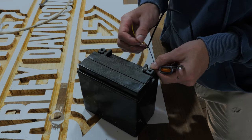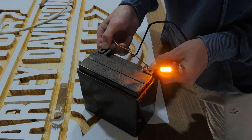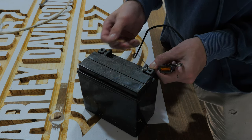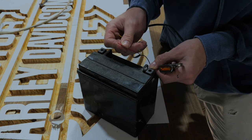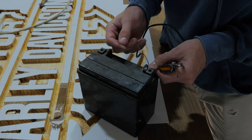Black wire to the negative terminal on the battery and then the red wire to the positive — and that looks pretty damn bright. Now I'll test out the yellow one, and as you can see the red wire runs brighter than the yellow, so that's what I'm going to use to wire up onto my bike as that will be the brightest light for my indicator.